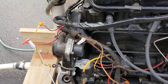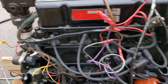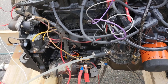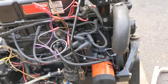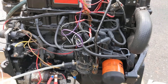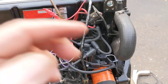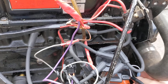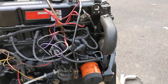So that's how the shift interrupt works — you just get that temporary kill like you normally used to. Now let's talk about timing. To time your motor you have to connect the white loop and connect the shift interrupt signal. They say you should have it running first before you put it into timing mode. So I'm going to connect the white pigtails, run it, and then send plus 12 in there. You'll notice once I do this it will not kill the engine. When we go into timing mode the two whites are connected and plus 12 is sent in — now it's in timing mode. That's why you have to have the disconnect: once you're out of timing mode your shift interrupt will not work if the two whites are connected.